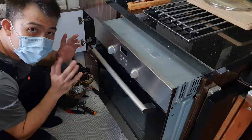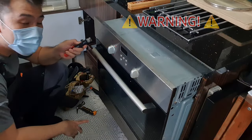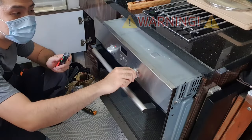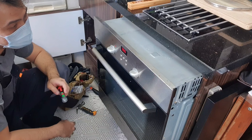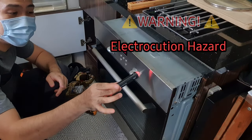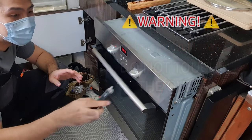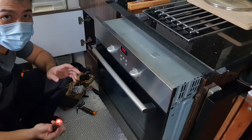The circuit breaker is on. Right now the main switch in the cupboard is switched off, so there should not be any current running through the oven. I am going to set it to 100 degrees in fan-force mode and turn the oven on. As you can see, my contactless voltage detector is going nuts — because the entire oven is live. You don't want to touch it. If you touch the oven now, you are going to get quite a nasty shock. The whole oven case is live right now.